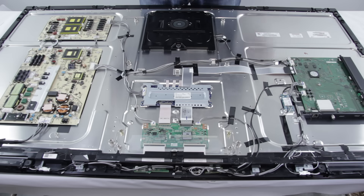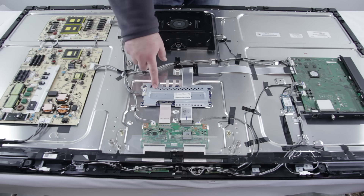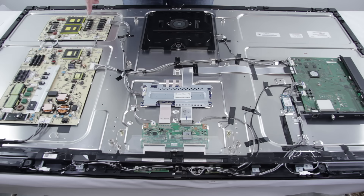The screen on an LED TV and LCD are the same. This TV has two power supply boards. Here we have the G7 power supply board. This provides power to the backlight inverter slash LED driver via this cable. The two power supply boards are connected to each other right here.